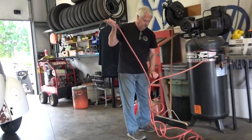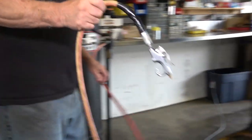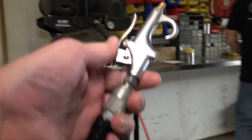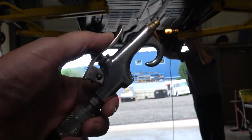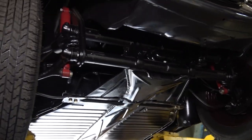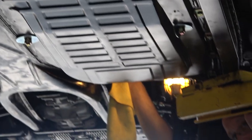Getting the big guns out. Here's our compressor, here's our hose. Get a nozzle like this if you can. If you don't have a compressor, you can use compressed air in a can or a bicycle pump — that works too. We'll go up in here, put it up on that fuel line, and blow it out to the back. I've got my dad blowing through the cut fuel line and Steve in the back with a rag to catch the fuel.